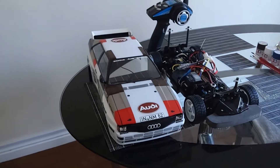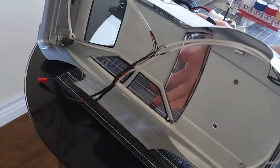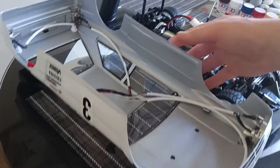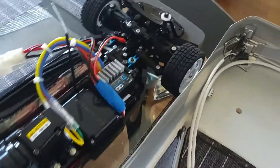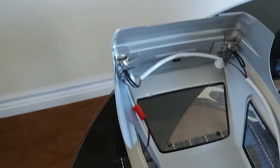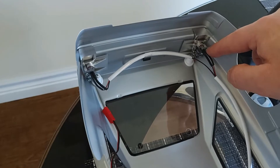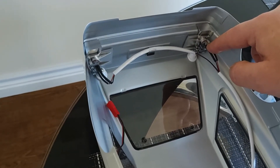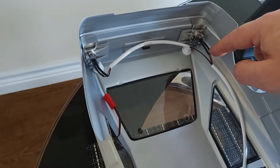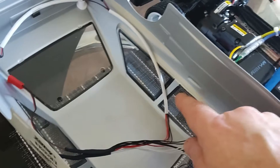In terms of the body, I've installed all the bodywork and I've installed the light units for the front and the LEDs. I'm running them down these cable sheathings here, and the same again for the rears. Where the LEDs and the wiring connect together, I've put a resistor on the negative — the cathode — which I've calculated using Ohm's law.